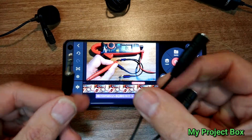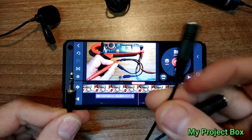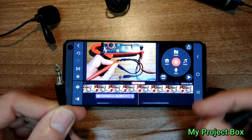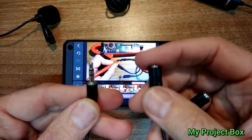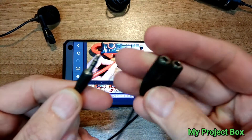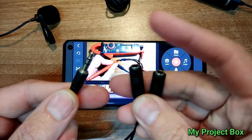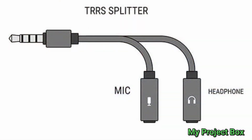So what should I do? Well, the obvious solution is to have some sort of splitter cable that splits the headphones into one socket and the mic into the other. Now I have tried several cables before — like this one — but this doesn't work because this is headphones only, not microphone. This just gives you two sets of headphone output.